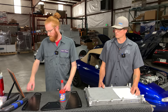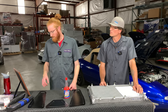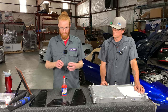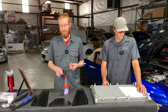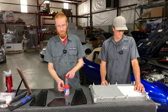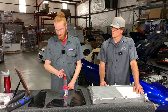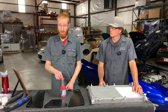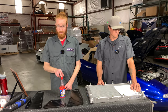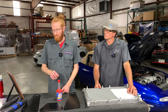Question: what is the correct or best way to run Water Wetter? Mixed with coolant, or water wetter with distilled water only? Is this safe for a street car that sees cold weather? You don't want to mix Water Wetter with actual coolant — it will cause deposits that build up in your cooling system that you'll then need to clean out. If you're running just distilled water, we recommend adding Water Wetter because its additives are similar to those in coolant and help keep your engine from rusting inside. However, this does not offer any freeze protection like coolant does. So in the fall, if it gets cold enough to freeze and you're still driving your Miata, you will need to swap your distilled water and Water Wetter out for actual coolant.